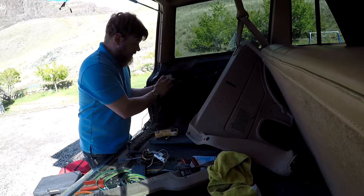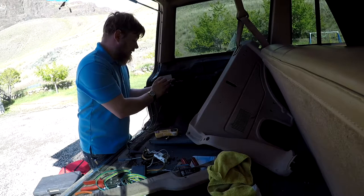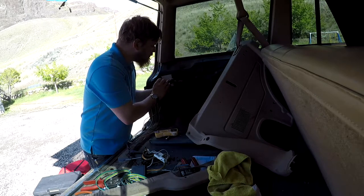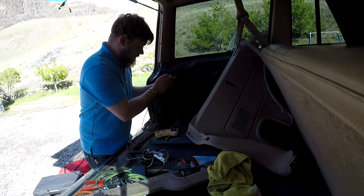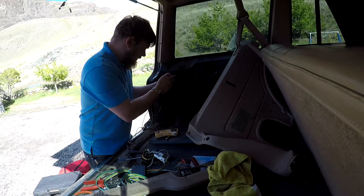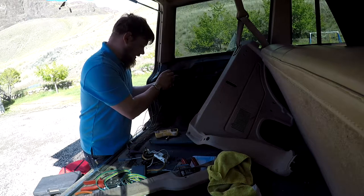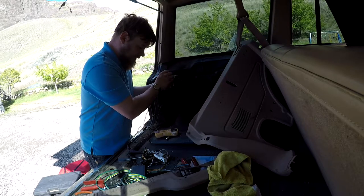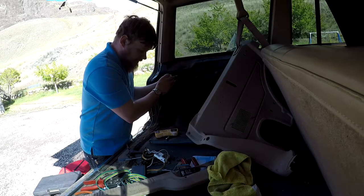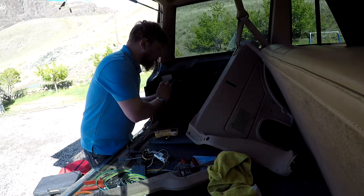You want me to look behind the brake panel? Nope. You got brakes on? Yeah. Brakes off? On? Okay, so just keep holding on to it. Just look at the bulb that's lighting up for the brake light. Ooh, that one was 10 volts. What about you? No. That's nothing. That's nothing. That's nothing. How about this one? That's nothing. All right, so our brake lights are the two whites.